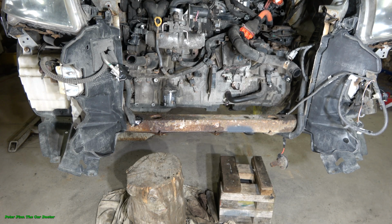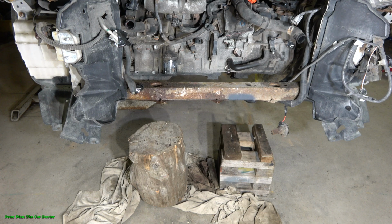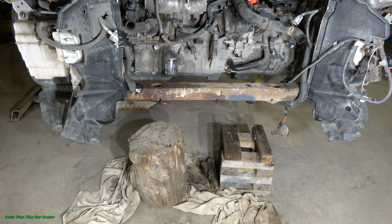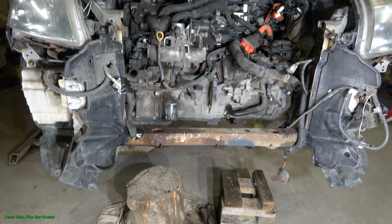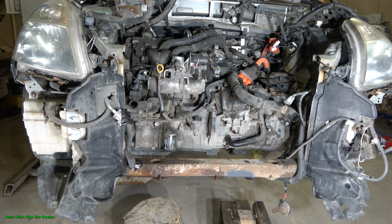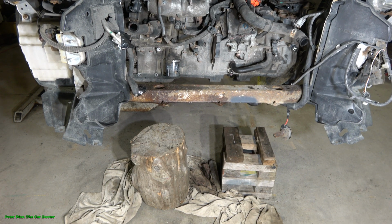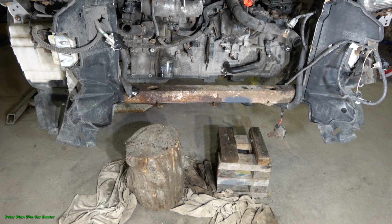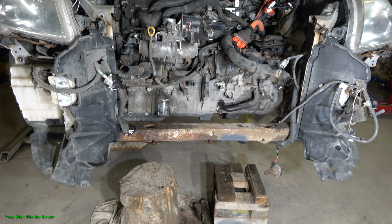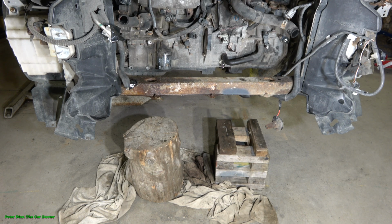And then in this Prius engine and gearbox removal, it is important that we install support jack stands below that engine, because soon this engine will collapse a little bit down, and there have to be steel or wooden support things below the engine block and this gearbox block. Good. And let's look at how we adjust this engine directly in this area.